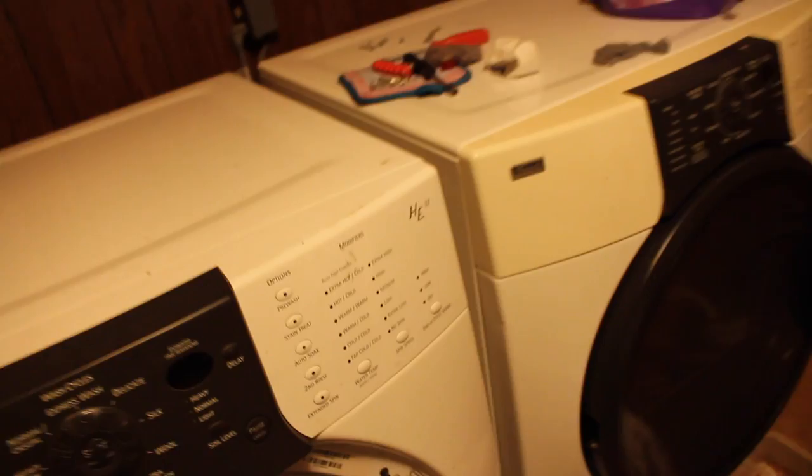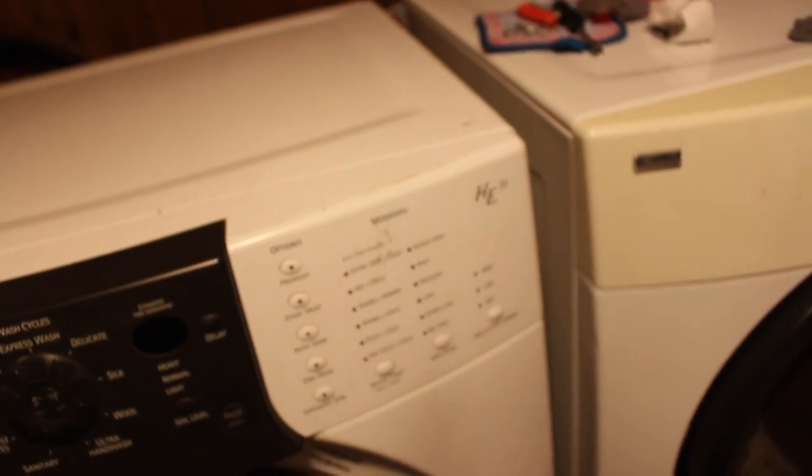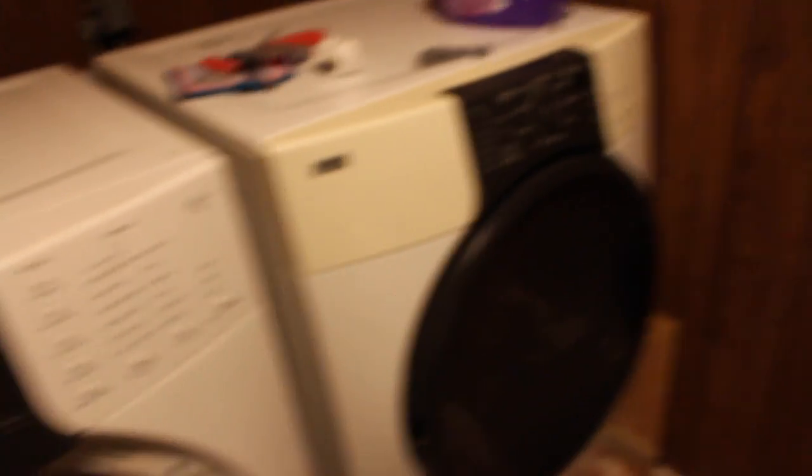In the back here, that's the drum and the belt. They're fine, but the bearing is out on this thing, on the tub. I'm afraid it's always set on high when it spins. So I've been using it on low, on extra low, and it takes longer to dry then. But the dryer works.